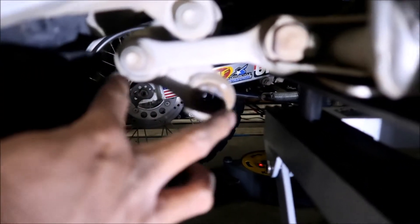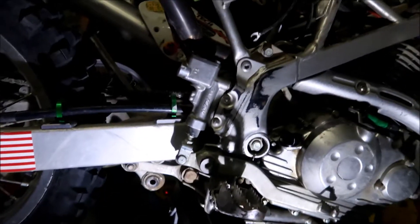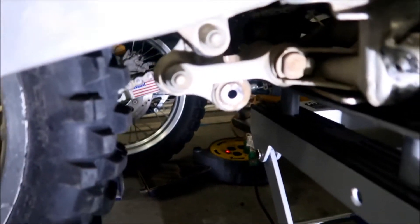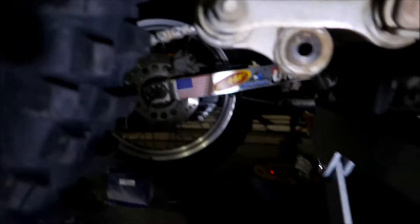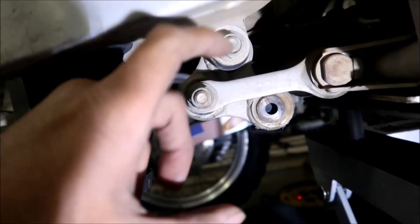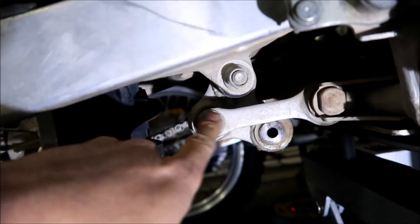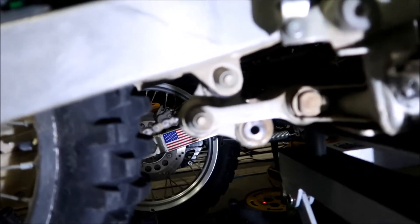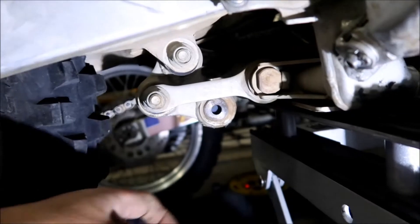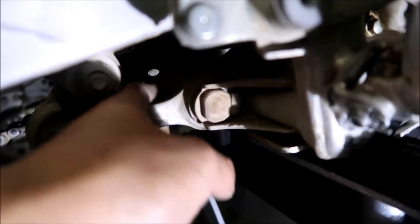These are the dog bones and there's a triangular linkage here. What we're going to do is flip it over. I'm gonna move the shock up and move the wheel up, and you'll see the shock move. We've got to take these nuts out and push this all the way through, then flip it. I think this hole is gonna go over on this hole, and this hole on that hole. I don't think they mean flip it horizontally — I'm pretty sure they mean flip it vertically, because the shock has to be on this at all times. And I heard you have to grind this part right here so it doesn't touch.